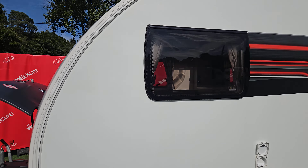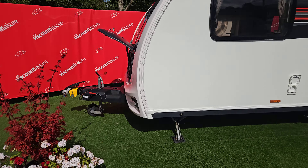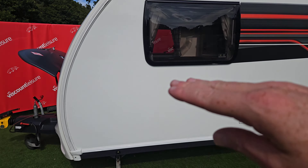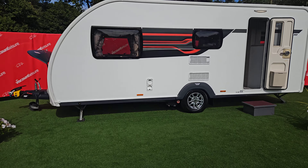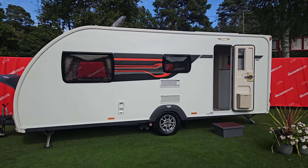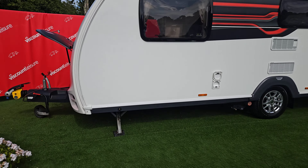When we first get to site, we want to make sure our caravan is nice and level — front to back and left to right. We use the jockey wheel on the front to wind up and down, which raises or lowers the front of the caravan. Use a spirit level on the A-frame or inside the door. If you need to level side to side, you can use leveling wedges and drive one wheel up onto it to raise one side of the caravan.